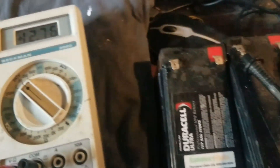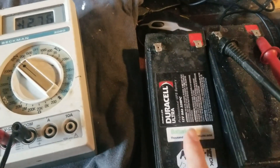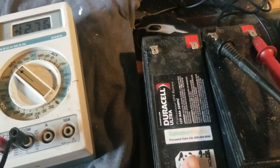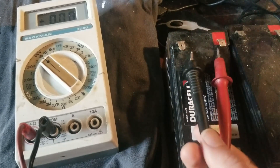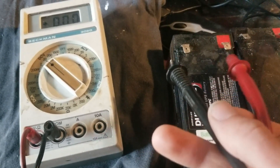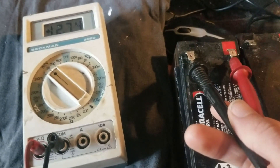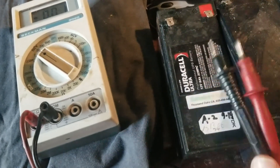The point is, this battery has been reading a steady 12.76 volts. Before we did any desulfating on it — which lasted about 12 hours — it was reading about 12.36 volts. It was above 12 volts but definitely had less sitting voltage. Now when I hook it up it's reading just about the same at 12.74.